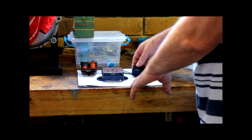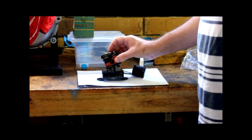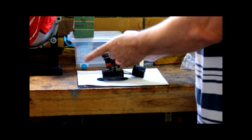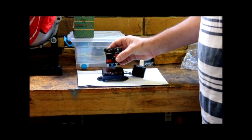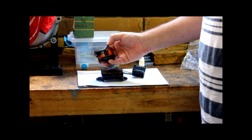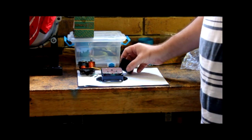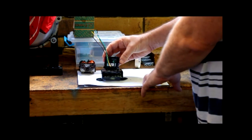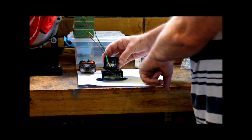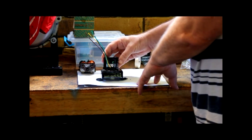So we're going to fit the electronic voltage regulator — this gets rid of the mechanical marvel that was before, just for a little bit of modern reliability. Fun fact: if you put a battery in with reverse polarity, the things that will give that away — first off, your ammeter will rev up and be discharging rather heavily instead of charging. But also you'll hear these points on the regulator going absolutely berserk — it'll start whirring and clacking like a crazy thing. Not sure what happens if you keep it that way; it'll probably burn out. This is a 6V unit, but to make it 12V we just snip that loop wire — I guess there's a resistor in there that knocks it from 12 down to 6. Insulate the ends so they don't touch, but it can be un-snipped again if someone wants to change it back to 6V later on.